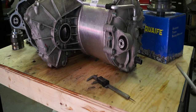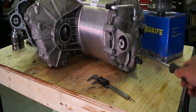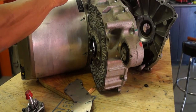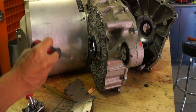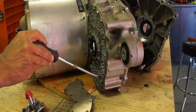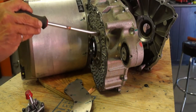The unit is water cooled. The coolant enters here, and the portion that goes directly in to cool the rotor then exits through this pipe here. The majority of the water goes into the casting to cool the stator. You can see where the water exits after cooling the stator, passes through this part of the casting, and then cools the power electronics exiting through the casting down here. The remainder of the water from the rotor passes through this controlled orifice, goes straight through the casting, and then cascades down through this heat exchanger where it combines with the water that just cooled the power electronics. Water from the rotor is likely at a higher temperature and Tesla decided to use this portion of the transmission case as an extra cooler.